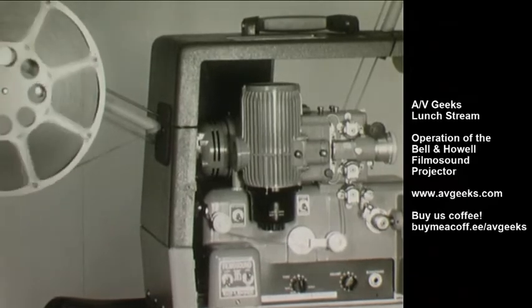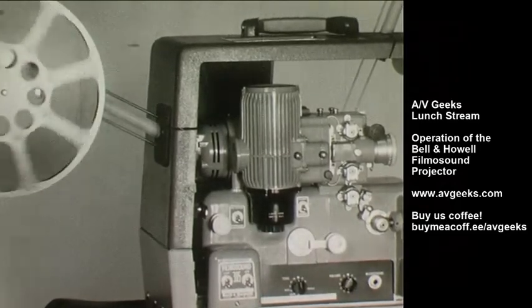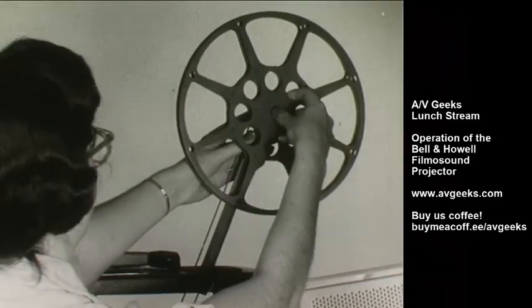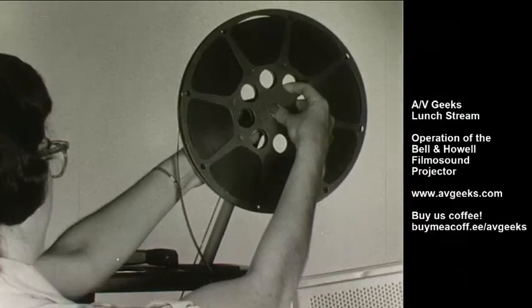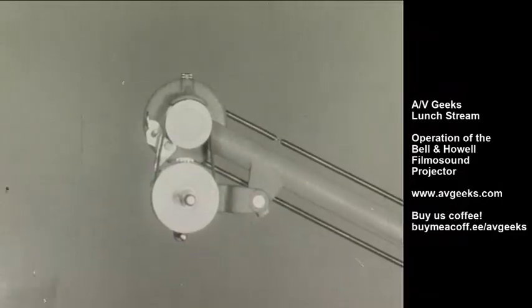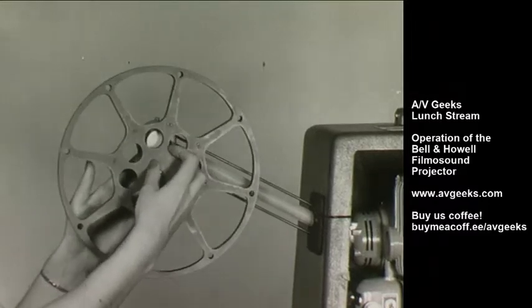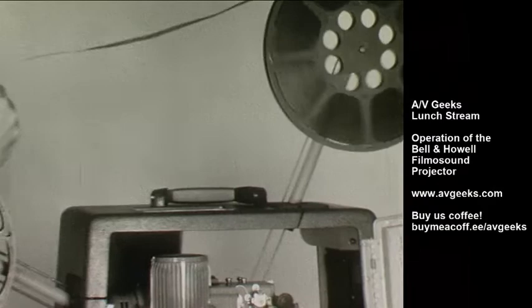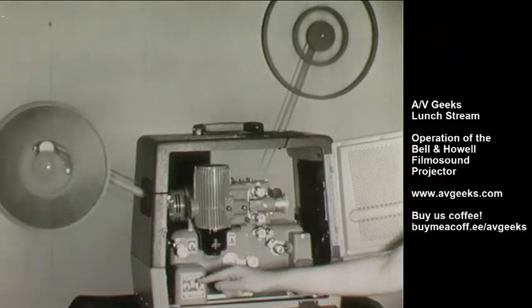The remaining leader should completely pass through the projector before the power line switch is turned off. To rewind the film, first interchange the positions of the two reels. Press the take-up lock lever in. Raise the spindle to engage the rewind gears. Lead the film from the full to the empty reel. Turn on the power line switch. Turn off the switch when all the film has been rewound.